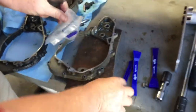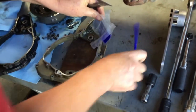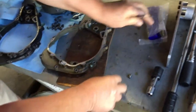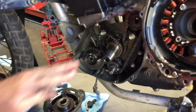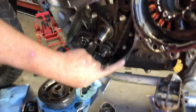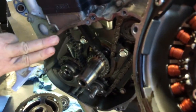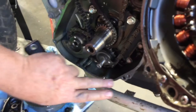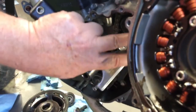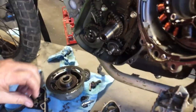So leaks, when you put everything back together, are usually caused by if you tried to take all the gasket material off and you left a chunk somewhere, that's gonna make a leak when you put the new gasket on it. Now this gasket is actually good enough if you were cheap and in a hurry. I would put a coat, a thin coat, so thin you could see through it, of Permatex number 2 all the way around this, and then use it like that.